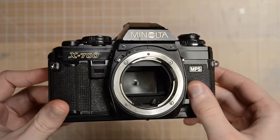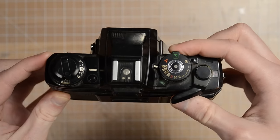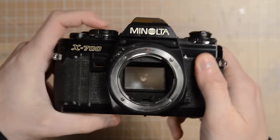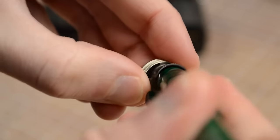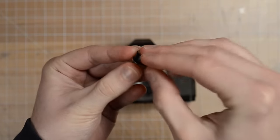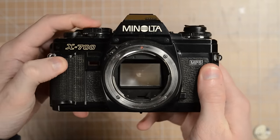Despite looking like it was buried underground for at least 20 years, the camera doesn't seem to have any physical damage to it. But as the listing suggested, the camera is non-functioning. Luckily, I know an ancient secret that not a lot of people are aware of, and I'm willing to share it with you today. All you have to do is clean. The problem usually lies within the battery compartment, which I'll clean out with an eraser and a bit of rubbing alcohol. By polishing up the surface, you can usually remove the oxidation that's built up over the years and create good electrical contact again. And just like that, our camera is now fully functioning once more.